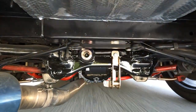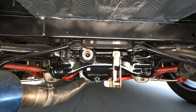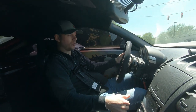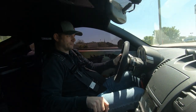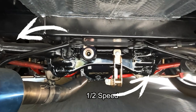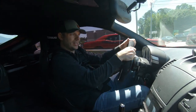Not from the new bushing — not really from the new bushing at all — but in the rear subframe itself there was a lot of movement. Reviewing the footage, it almost looks like the subframe had been removed or lowered at one point and not tightened all the way back up. There was a lot of movement trying to launch this car, we were getting a ton of wheel hop. That movement is not good — it could potentially lead to catastrophic failure of other components.